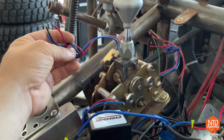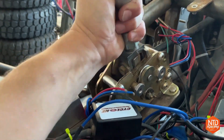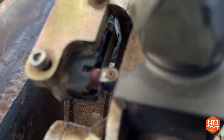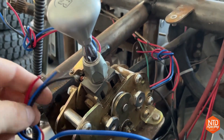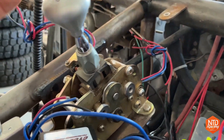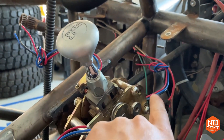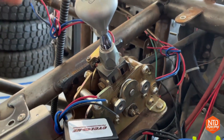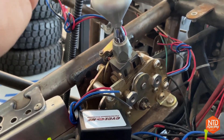Basically it has three switches, which I'll just call squat switches. The first one up on top — when you go all the way down into drive, you can see a little switch on the side. As I move the shifter into sport mode, it releases that squat switch and sends a signal to the transmission saying you are now in sport mode. That's when these other two squat switches on the front and back come into play. As I pull back on the lever it engages the front squat switch, and if I push forward on the lever it engages the back squat switch.